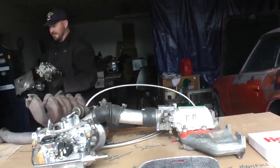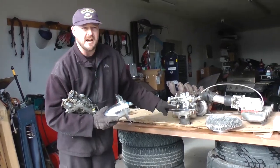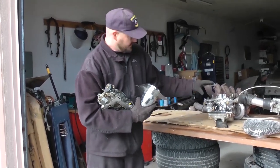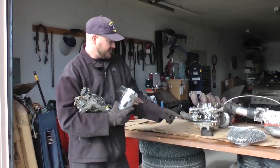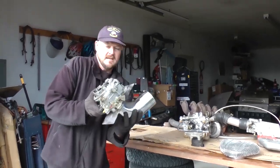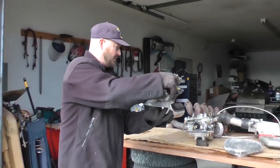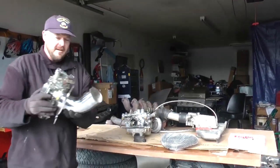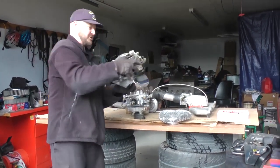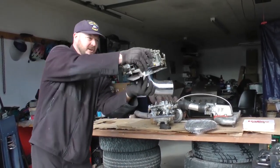If you don't have a fancy draw-through carb setup, this draw-through carb mount I got from a 1980 Pontiac Trans Am Turbo — it originally had a Quadrajet carburetor on it, but I used a spread-bore flange to allow a Holley-style carburetor to be mounted. If you can't find this type of flange, you can fabricate your own: a carburetor flange, a spacer, going to a big pipe leading to the intake of your turbocharger. All it needs to do is have a carb mounted to it, seal really well, and go to the intake of your turbocharger — that's all it takes.